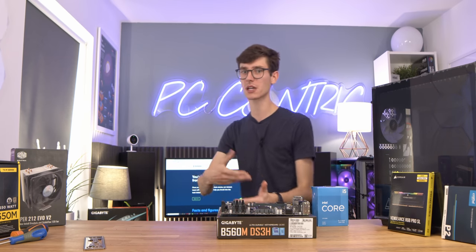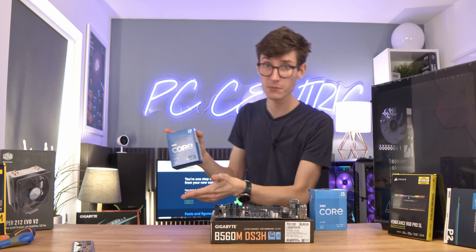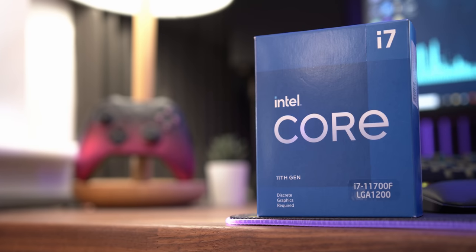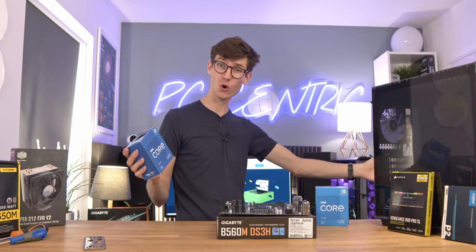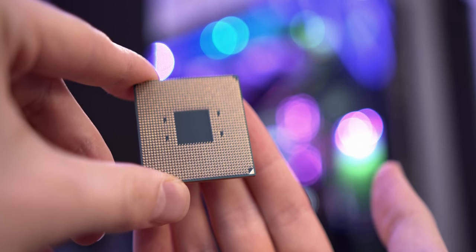However, if you're going to do something a little bit more in-depth with your PC — maybe some game development or anything that requires quite a bit more CPU power — then it's very easy to upgrade to the 11700F, which features two extra cores and is around about 80 to 100 pounds more. If you go for an Intel CPU you won't have any pins on the chip; the pins are actually on the board. But if you go for a Ryzen CPU then it is the other way around. Either way, please be careful with both the chip and the motherboard socket.